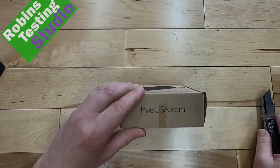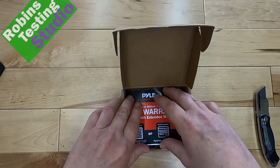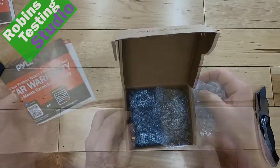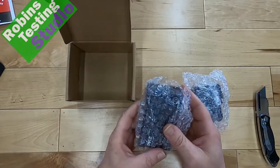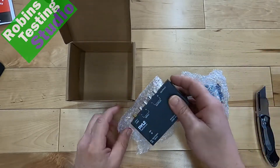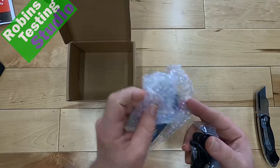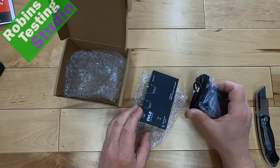The reason why you want a phono preamp is because you have an old turntable that doesn't have line level output and you're having a problem hooking it up to your new system. Regardless if that system is a home theater system or just an audio receiver, maybe you just want to plug it into some powered bookshelf monitors — it could be as simple as that. It may also be getting plugged into a powered speaker, or if you're plugging it into a mixer controller — that's the kind of thing you have to think about.